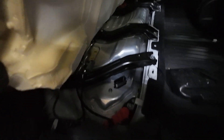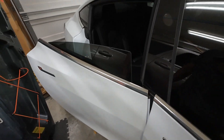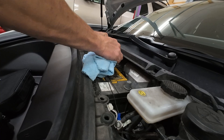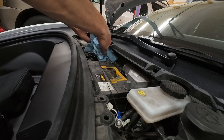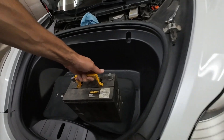Make sure nothing is touching in the high voltage area — critical step. Leave your doors open. Now the next step is to disconnect the positive side. It's the same as the negative side. Now we've got this up and I'm just going to cover it.